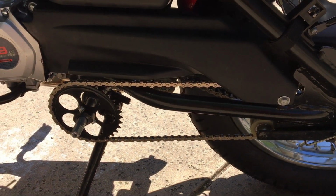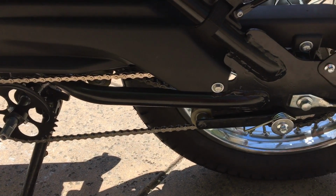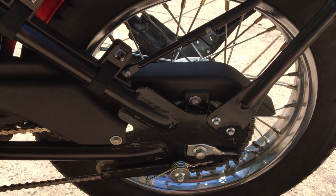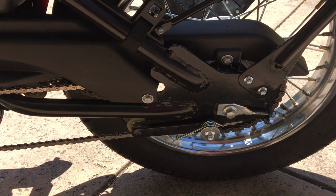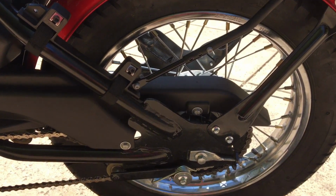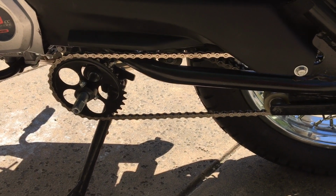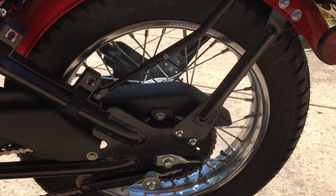There's going to be a grinding noise. If you keep the stock bike chain on there, it's going to pull the bike sprocket, and it's going to rub against just all those internal bearings. So I had a grinding noise. I didn't know what it was from. I thought it was the new chain and the misaligned wheel, and it kind of was, but it was really this bike chain is too tight. But make sure to get a new bike chain if you do get a bigger 428 motorcycle chain.